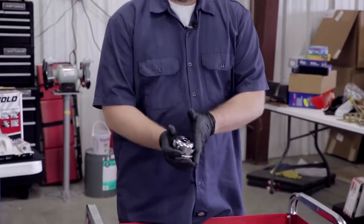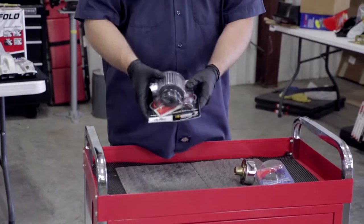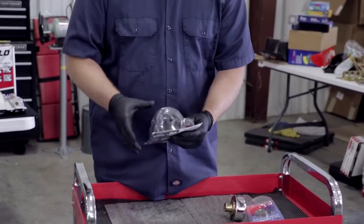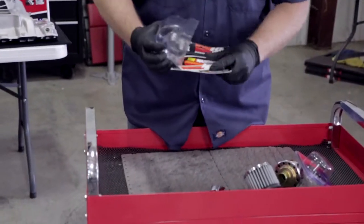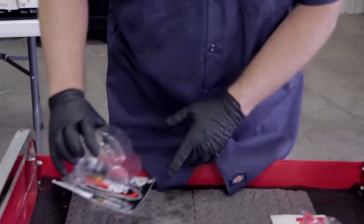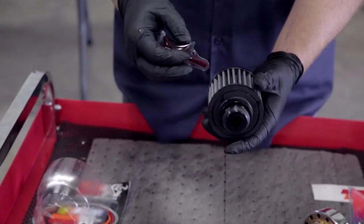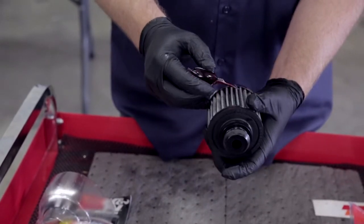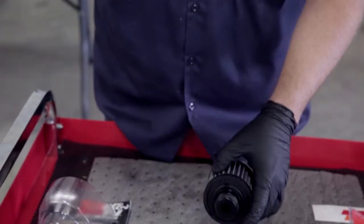I wanted to show you a couple of different options you have with your breather. You have your standard crankcase breather that does require a grommet if you're going to use it. The ones we're using are actually the K&N, which has an oiled filter media just like most K&N filters, and it has a grommet already built onto it. The part numbers for these will be in the description. With K&N, you always get a decal for your vehicle. This is the oil — the instructions are on it. What you actually do is cut the applicator, run a bead along every ridge on the filter, wait 20 minutes, and then come back and oil it again. We'll show you that process, get it ready, and put it on our engine.